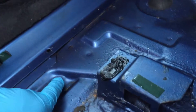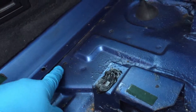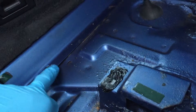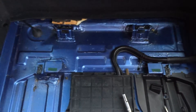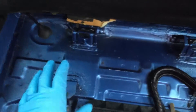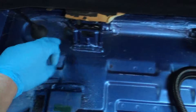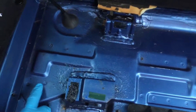You can even see that there's a gap where this boot floor panel has started to separate from the chassis leg - there's a good two-plus millimeter gap. So that's relatively easy; it's a couple of minutes' work to take the carpets out of your boot floor in your Z3M coupe and check these spot welds for any issues. If you haven't had a panel replaced before, you may have some seam sealer over this area which means you can't see these spot welds very well - you might need to take the seam sealer off. But even so, that's what a broken spot weld looks like and that's what you need to identify.